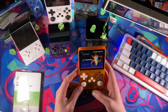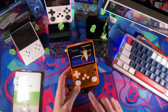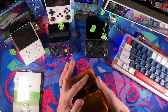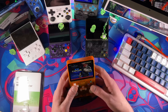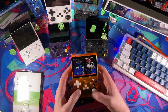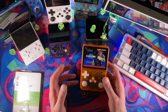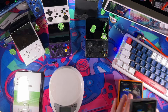That just gives you a quick peek of the setup I got here for the R36S — this is about as most modded as you can get it. I know you can put a Wi-Fi card in here though — people have been putting the wrong one in, trying to Dremel out a space for it. You should just be able to put the Wi-Fi card in off the RG353V and VS. I just need to get a hold of one. We got a little sticker mod — adds horsepower. We got our better back buttons. I was going to do a battery mod, but really the battery life is pretty decent. We got a D-pad and face buttons from CloudLife 6, Sakura Mod PlayStation buttons, Hall Effect sticks, and a Wi-Fi adapter.